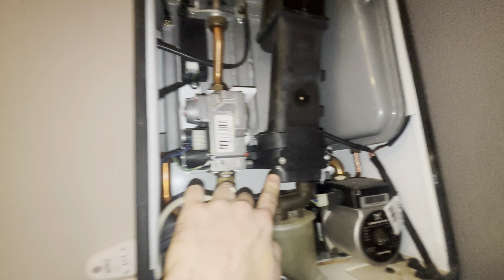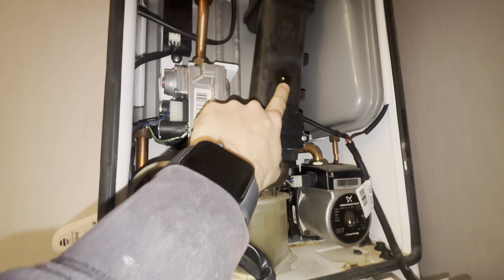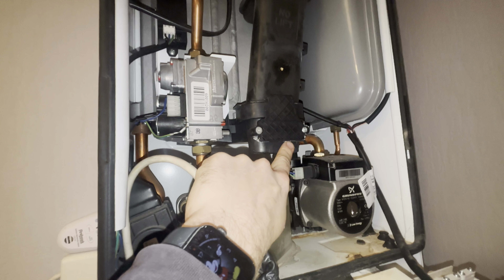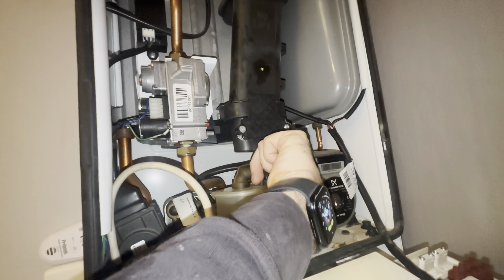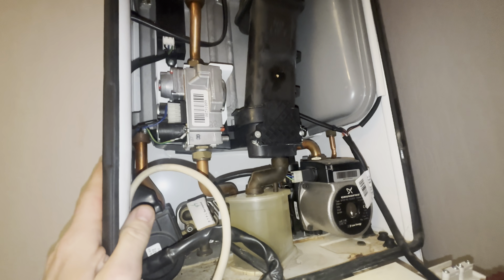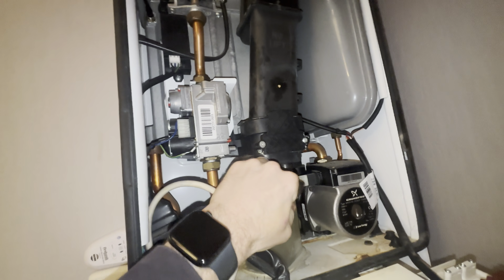The reason we turned this one off - you can see the white around here, and it's starting to appear here too. The sump's cracked on it. It's a very early stage on this one; I've seen them a lot lot worse than that. Around the other side as well there's a bit of white - yes, cracked. So what we're going to do is get this one replaced.